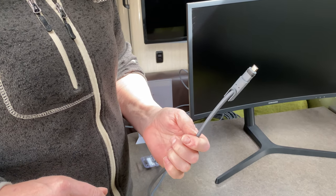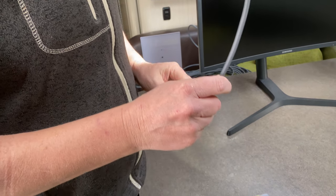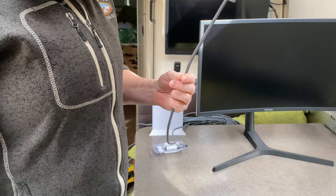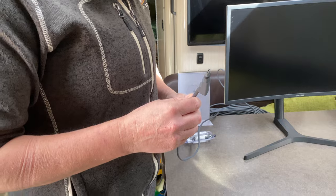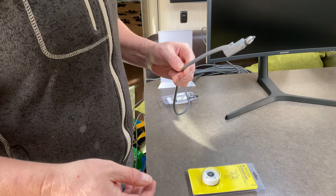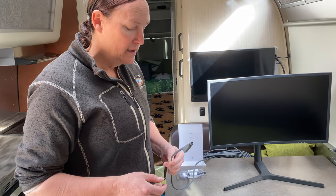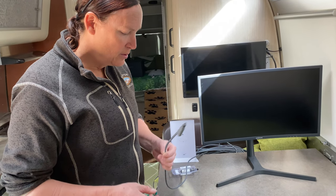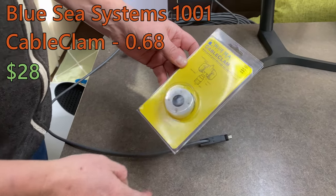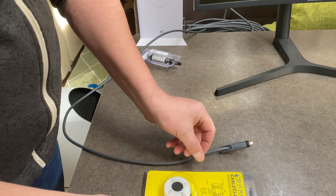This is the more civilized end of the Starlink cable. We're going to attempt a summer without cutting this cable, which we know is a Cat 5e shielded Ethernet cable. So we're going to drill a hole in the Airstream and feed this cable through. One of the questions becomes: now that you've drilled a hole, how do you environmentally seal it? Looking under the Airstream, the standard way of sealing holes looks terrible because it's caulking — it's hard to remove, looks crappy, and attracts dirt.